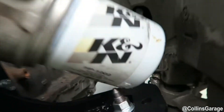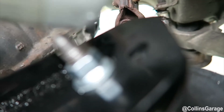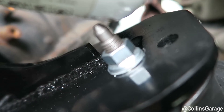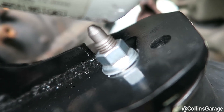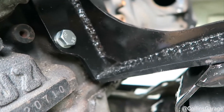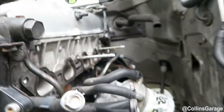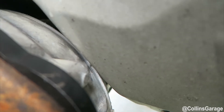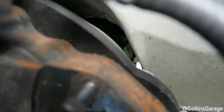You can barely see the slot on this back one right here, but we got this motor mount all the way back. Once you get yours positioned where you need it and leveled out, you'll also see that the limiting factor is the trans tunnel. If you want to hammer it in just a little bit right there to give it a little more clearance, it's got enough clearance that it's not going to touch.